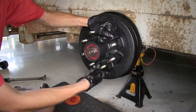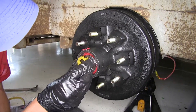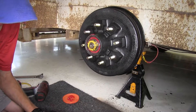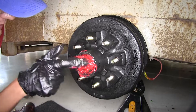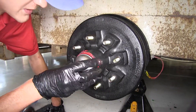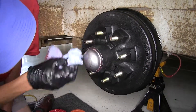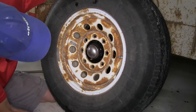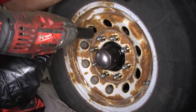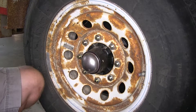We have to adjust the brakes a little bit here shortly. Now I'll reinstall our tab which holds our lock nut in place. Before we reinstall our grease cap, I always like to take a little bit of grease and put it in there, just so it can work its way into the bearings if needed. We'll take our new cap, place it into our hub, and tap it in. Clean off any excess grease. I always like to put the wheel and tire back on the hub before we adjust our brakes, so we can rotate the brake assembly easier and get the proper feel. Now we'll tighten down our new lug nuts — they use a 13/16 socket — making sure we go in a criss-cross pattern. We'll torque all our lug nuts once we have our trailer back down on the ground.